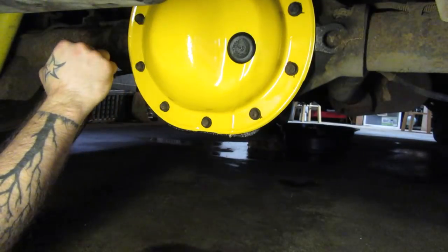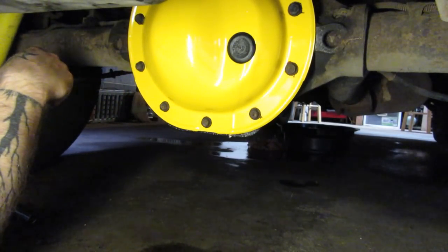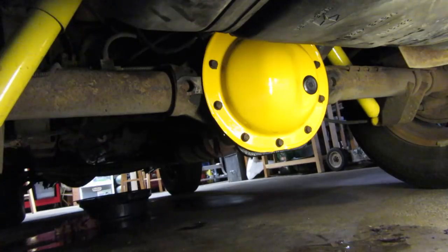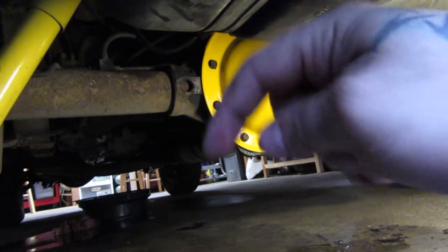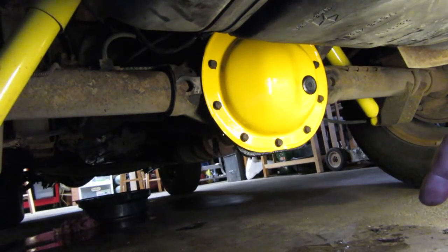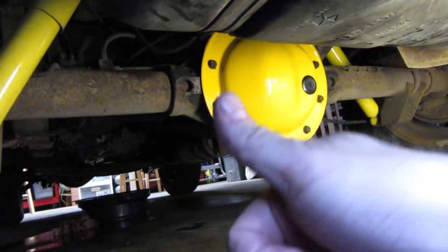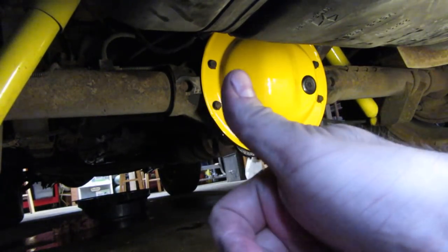We're going to clean up this oil and let this paint dry for another day before we really get her into some stuff — but that's all she wrote. You're supposed to do this about every 50,000 miles, and certainly any time you've had your Jeep submerged where there could be water inside your transfer case or differential. If you have any questions, leave them in the comments and I'll do my best to get back to you. Hope you found the video informational, educational, maybe even a little entertaining. If you did, by all means like the video, subscribe to the channel. Thanks for watching — I'll see you next time.